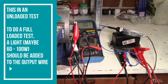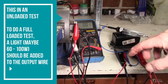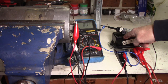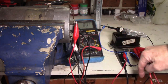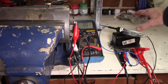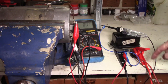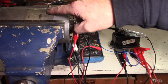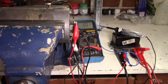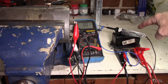I've now got all my connections hooked up on my regulator and generator. On my regulator I have my positive and negative from a battery downstairs. I also have a globe hooked up here — it's just a test light — going from my D positive output which is connected over to the D terminal on the generator. It also goes through the light, so once connected that should glow, and once we get voltage being produced it should put it out. And this F wire goes onto my DF field windings. I've also got it earthed from here down to my battery. I'll connect it up and we'll crank it up to see what sort of voltages we get — if they're regulated voltages and if that light is going to go out.